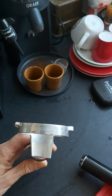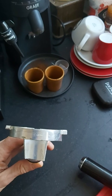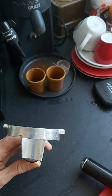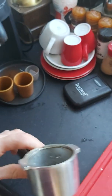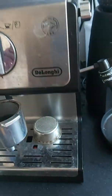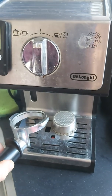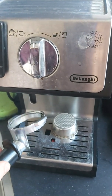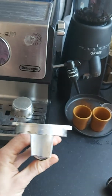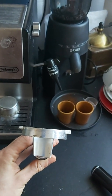You can also see from the front that it's formed a concave line there, which does not provide the proper seal that a straight line does when inserted into the station. What I encountered was, while trying to make single shots with this one, that the coffee sputtered all over the place. It had just lost its seal and thus has become worthless to me for making coffee right now.